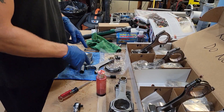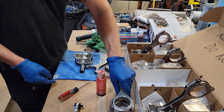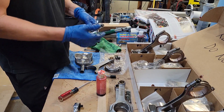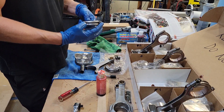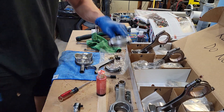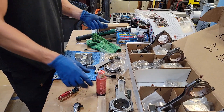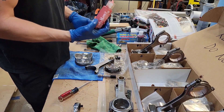Assembling the rods to the pistons is pretty easy, but one thing to note: if you get these Pro-LS rods, the bolts come fully torqued so they're on there pretty tight — definitely a little bit of a challenge to get off, just trying to be extra careful. We want to coat everything up with some assembly lube.